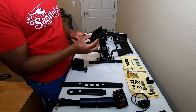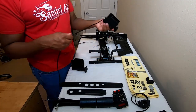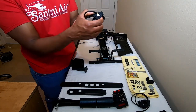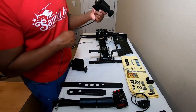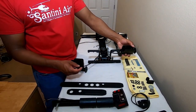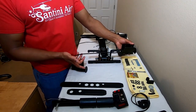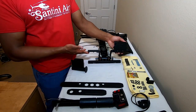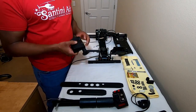And if you have the toe brake mod, putting these on can be a little tricky. Because of the toe brakes, you have two screws that go in here and you have these washers. I'm not sure if you guys can see that or not. So if you just try to put them on straight away, they're going to bump into those nuts there. So I said washers, they're actually nuts. In order to get these on nice and easy, just rotate them 90 degrees, slide them on, and then there you go, just like that. And it should line up pretty close.